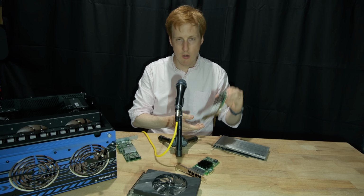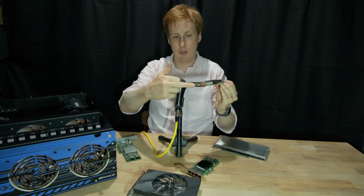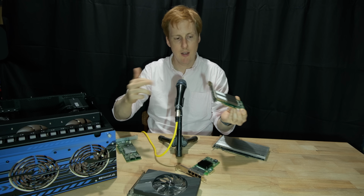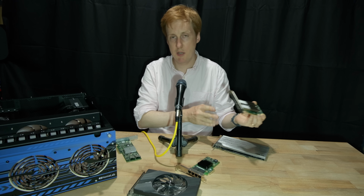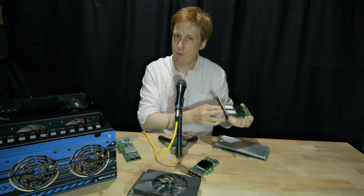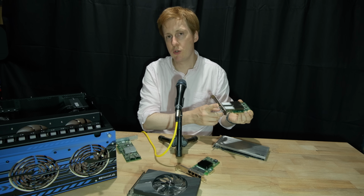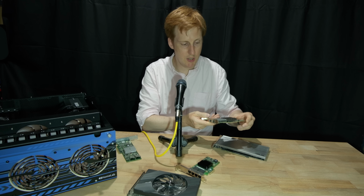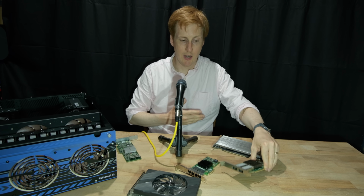So for example, this could be, say, a dual LAN intake, or maybe if you've got really fast internet, you could have this as a WAN port. But it's possible that maybe that's overkill for the firewall. Maybe I'll use one for the actual LAN port, and then maybe I could use the other port for all of my virtual machines. They'd all then get to share a 10 gig connection.